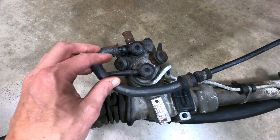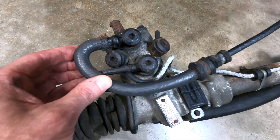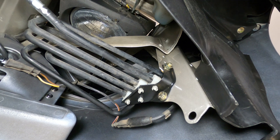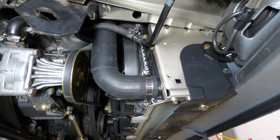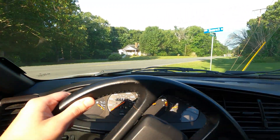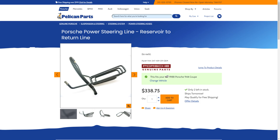On the back of the steering gear tower, there are some connection points for the hydraulic lines, and you may find that these are hex head bolts, which tend to strip out during removal. To replace these, Rembe offers a set of 12mm banjo bolts that are a little bit easier to work with for about $20. The metal cooling line located in the front right corner of the car is another part that can occasionally get clogged up in the bends when incorrect fluids have been added to the system, which may cause heavy steering and a noisy pump. If you suspect the cooler line is clogged, it can be disconnected, drained of fluid, and then compressed air can be forced through the line to clean it out. If the hard line is crimped or damaged, they can be replaced for about $330.